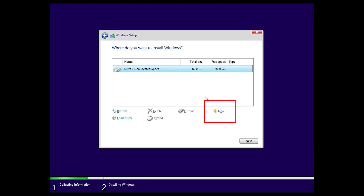One thing to note: when you get to the hard drive section during install, I went through the custom install and made sure to only set it to install on half the free space rather than the full free space. You do that by hitting the new partition button and specifying the size to be around half of what's available. Windows 10 installed fine. Wi-Fi is working, though I'm using the Microsoft default display driver. Watching YouTube at 1080p does max out the CPU at 100%. Also the trackpad isn't doing everything it should — I can't get gestures to work. But besides that it's up and running, great for productivity, web browsing, and you can still watch 720p video without much problem. Netflix and so on all looking good.